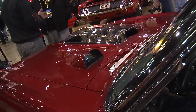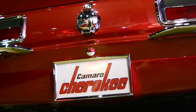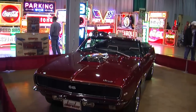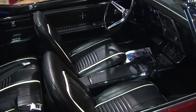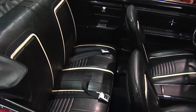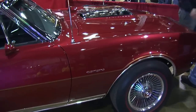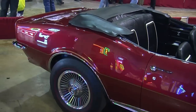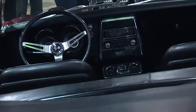So when you got it, the question comes up about the one-off pieces — the split bumpers, the hood scoop, this ducktail. Were you able to preserve, clean up, polish, or reconstruct? Yes, everything. We completely stripped the whole car. There's a lot of fun features because when they did it at the factory, they never pulled the front clip off when they repainted it. So when we took it apart, the firewall extensions under the fenders were still white — because this was originally built in white. When we took all the chrome moldings around the windshield posts off, all that's white paint. So we never stripped any of that original white paint. On the A-pillars, they never pulled the rubbers out when they painted it — only the door rubbers, not off the windshield posts. They just masked all that off while there's still white paint up in there.